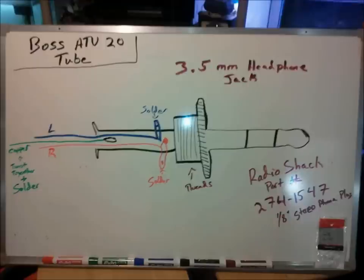Okay, this is just a quick dry erase board drawing of what I've done. In the green is noted your two bare copper wires that were stranded, a bunch of strands. They're your grounds, and they're located there as the green. You want to twist those both together and then slip them through that big hole on the main ground lug there that has two ear tabs sticking off of it, and that's just crimping down on your outer black insulator wires. Solder those there, left and right. I'm not sure which one's which. Doesn't really matter for this purpose.